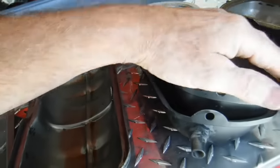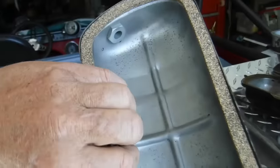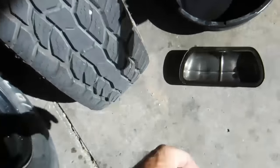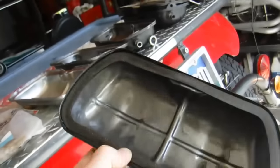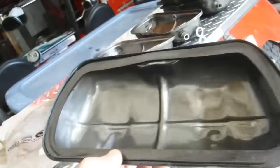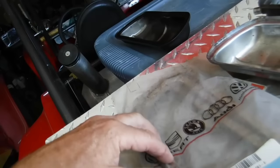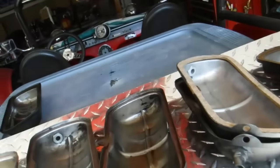Look at that — it's laying in there pretty flat, pretty nice. That is a Volkswagen valve cover with the little emblem right here. Now this one on the floor — sold as original equipment manufacturer — but that gasket's not happy. It's too small. Whatever they're using to stamp out these valve covers is not the same, or whoever's making the gasket is not cutting them to the right size. That gasket needs to lay in here comfortably, relaxed, and you won't even need any sealer to hold it in place.